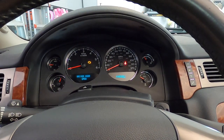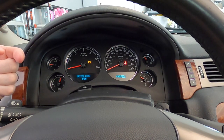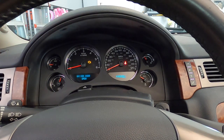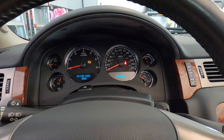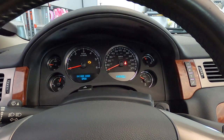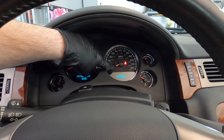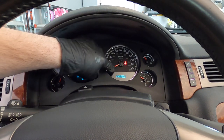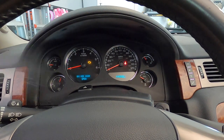Okay, that's done. The importance of that step is to get all of the loose dirt and dust off as possible, because if you leave all that stuff on there you tend to just be wiping dirt around. So you want to get all the loose dirt off first. Now we're going to spray our heavily diluted super light glass cleaner onto everything in this area. One thing you probably noticed when I was vacuuming is that I had the detail brush and was brushing this clear plastic, but I was not applying much pressure at all, because I do not want to scratch it — I've done it to people's vehicles by accident in the past and learned very quickly not to do that.